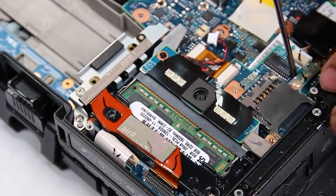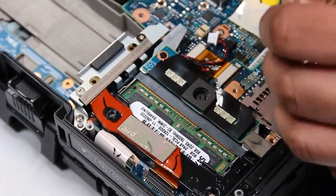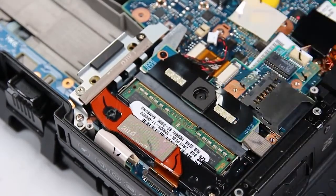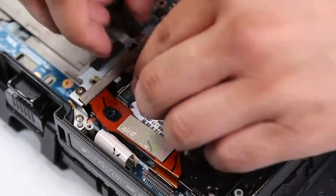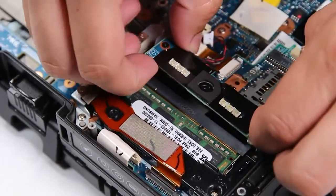You don't actually have to remove the SD card board, you just need to loosen it a little bit. Two of the screws holding the SD card board also hold down the camera. So disconnect the camera, position it a little upwards, and then you can slide it right out.